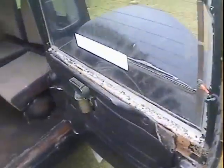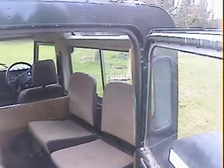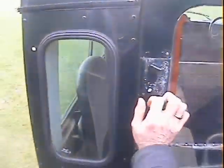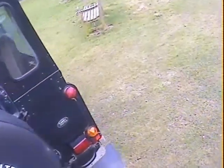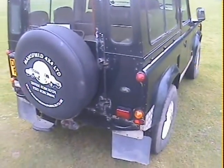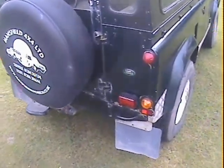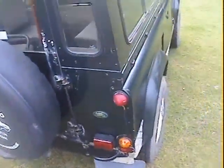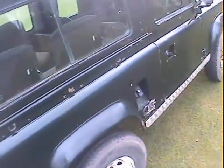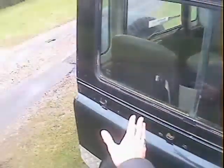The bottom edge door card is a bit ragged, but the tailgate itself is actually pretty good — it still supports the spare wheel and the bottom frame is okay. Looking down the off side, it's very, very straight — uncannily so. There's a fair bit of paint loss around there, and looking at the off side eyebrow, it looks like it's been hand-painted in the same colour with some brush marks, though the rest of it is properly sprayed.